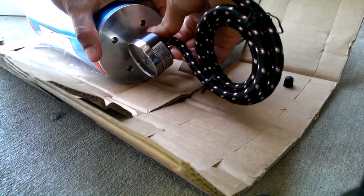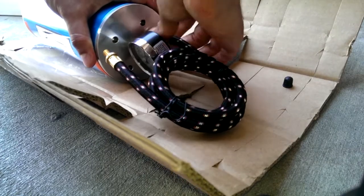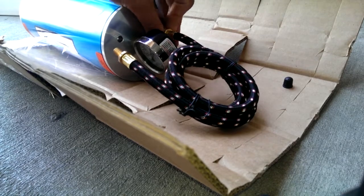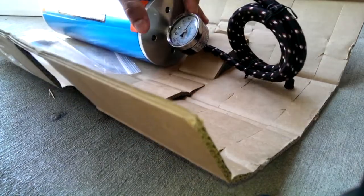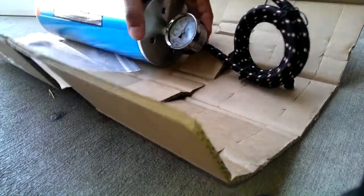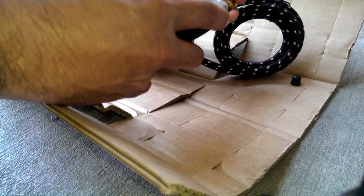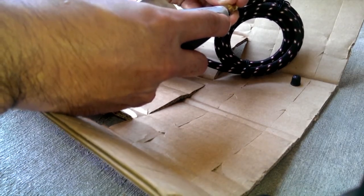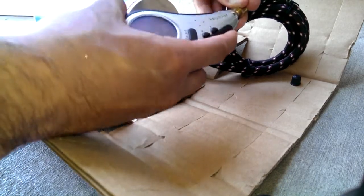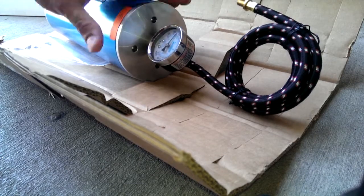Since we're going to be hiding this in the trans tunnel — that's what I'm calling it now, the transmission tunnel on my Cayman — I need to make sure that this is able to hold pressure. Just the way AccuSump sent it out to me with 40 pounds pre-charge to ensure it's airtight, I'm going to set this to 40 pounds. I'm going to see what the pressure gauge on that is compared to this AccuTire. 32 — that looks good. Nice 30. I'm going to pump this up to 40 and leave it overnight and check on it in the morning.